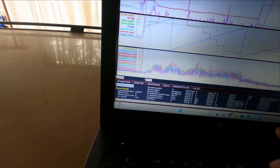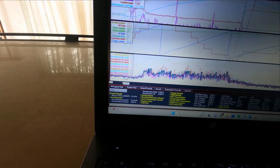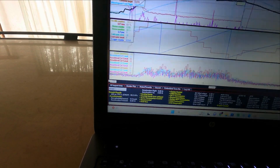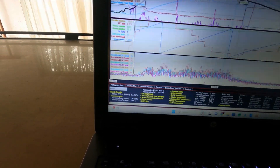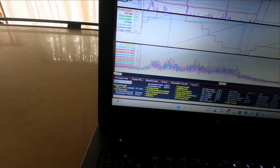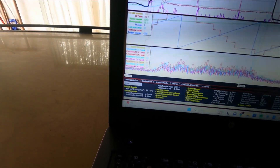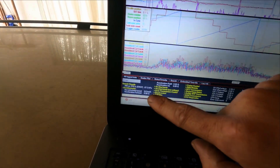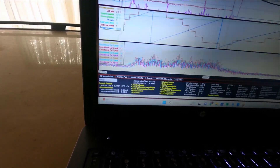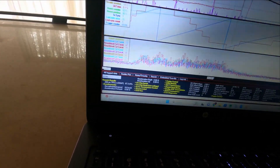What's also very interesting is the EMAP. Last time on the dyno I had a boost pressure of 0.7 bar and my EMAP was 1.7 bar — 170 kPa. Now when I'm running at 180 kPa of boost pressure, my EMAP is only 67 kPa. That's lower than atmospheric pressure, which is 80 kPa. So I have more than 100 kPa less backpressure compared to the old turbo setup — that will only bring more horsepower.